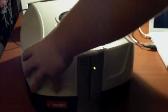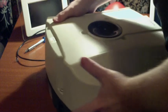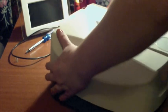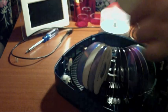So what we want to do is, first of all, we want to unplug the disk stacker. And we want to undo the two screws here and here, which I've already done. So I can just go ahead and pop it off. Grab the back, separate it, pull towards the front, get a bit of a jiggle and a pop, and pull the top off.